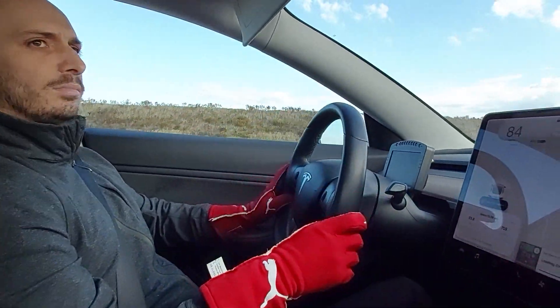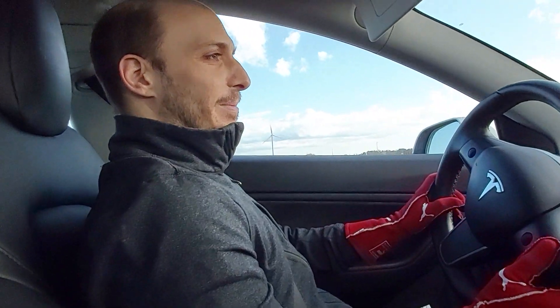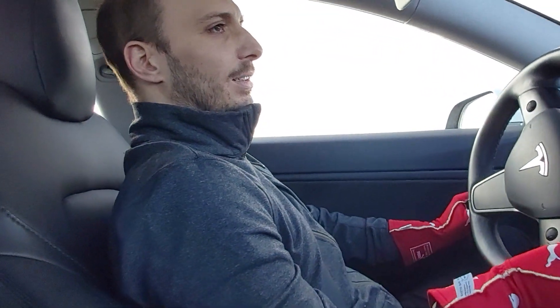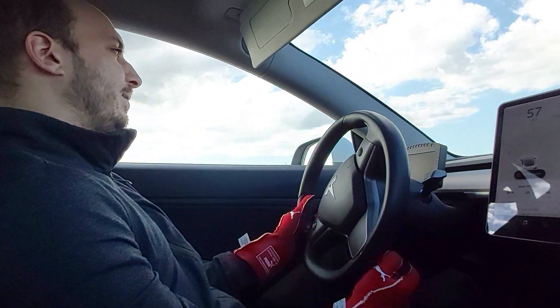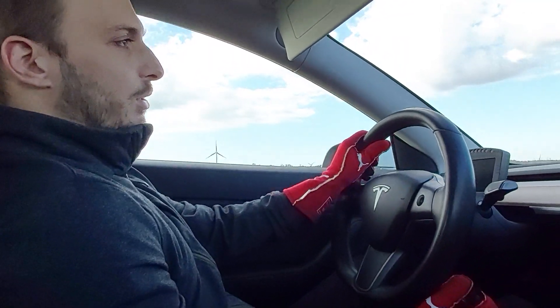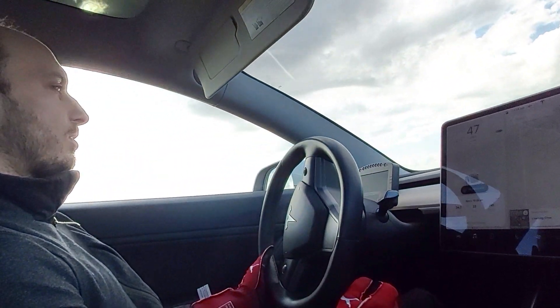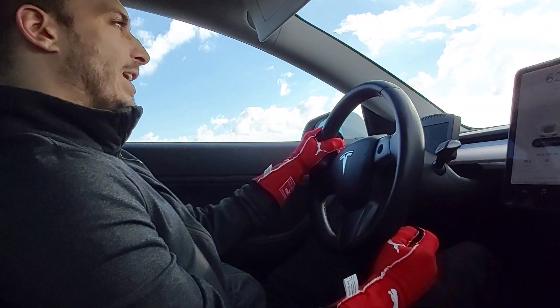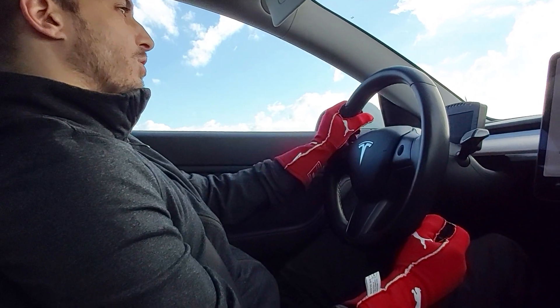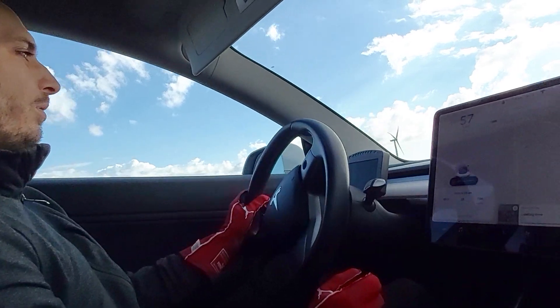Alright, give us the rundown Jesse. I feel like Max on the ring — I can't feel my legs. We did pretty good but we won't know until we pull the oil cooler off. We did a good seven or eight laps before power reduction happened, then we got one or two small power reductions that came and went, and after about 12 minutes we were into full-time power reduction. Worth pointing out this is a rear-wheel-drive, so the rear drive unit is doing a lot more work because you're not spreading that acceleration over two motors. It's going slower in a straight line and spending more time there, whereas a faster car spends less time at full power. So the percentage of time at full throttle is much higher with a lower-power single drive unit car.